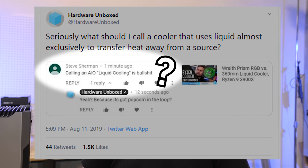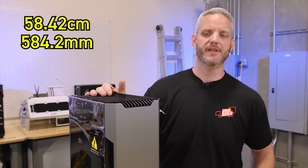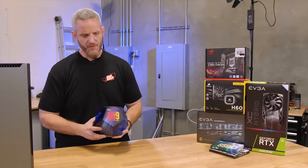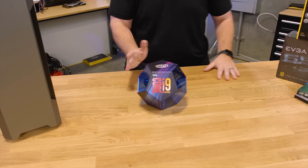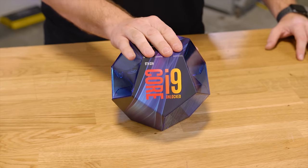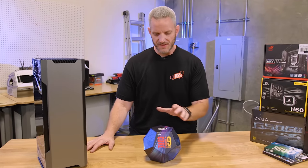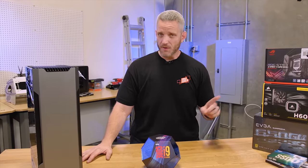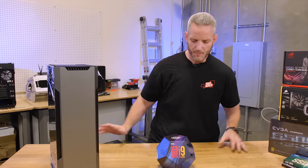It's kind of sticking close to my heart with water cooling. There are always debates on whether or not AIOs are truly water cooling, although they're filled with liquid and they use a heat exchanger and a pump to move fluid. They also have a Shift X version, which is quite a bit taller — almost 23 inches tall. Before you guys start throwing things at the computer going 'but I thought Ryzen 2 was the best ever' — 9900K. The reason why we did that is because we want high clocks, shooting for five gigahertz plus. Because this is a primarily gaming-centric build, the 9900K and its superior clock speeds versus the new Ryzen 2 stuff is going to give us benefit here. I have other plans for ITX on X570 once the 3950 comes out, so there will be ITX small form factor stuff for AMD with a whole separate purpose.